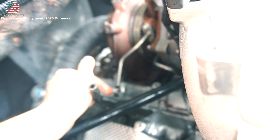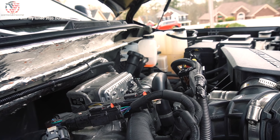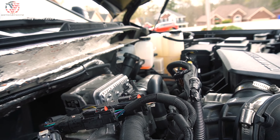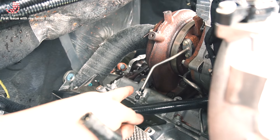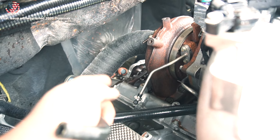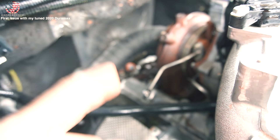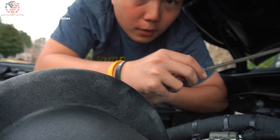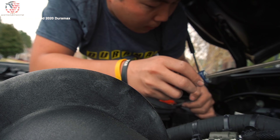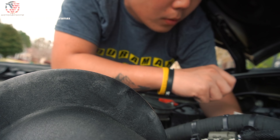I need the truck to run, so either I order that cap — which is what Holden has — or we reroute this back to the coolant reservoir, which is what other people do. Let me know in the comments if you have a 2020 — are you capping it off like the older trucks or rerouting it back to the coolant reservoir? I think I'm going to route it back to the reservoir instead of getting a cap. I was definitely freaking out last night when I got home because my truck was smoking, but it turns out this cap is a common issue.